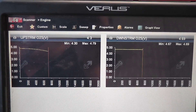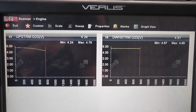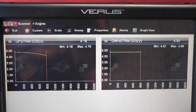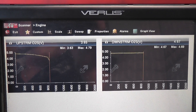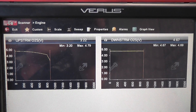If this heater were working, this 5-volt bias being sent to the sensor would already be down to half a volt. It's been at least 30 seconds since startup and you can see our voltage is still high.